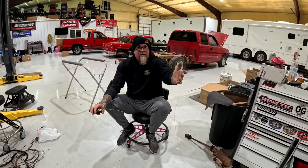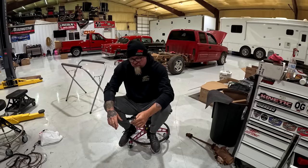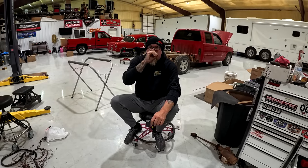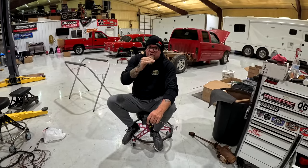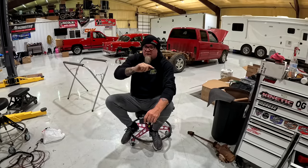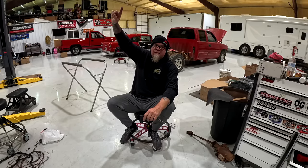What were we leaving at? 4,500? Was it that high? I know it was 3,650 at one point. But the converter was loose early. It's pretty tight once you lock it up, but early it was loose. So we tried to leave pretty low and then the thing would rip up, up, up, and flash up to about 6,000, just getting a big run at the converter.